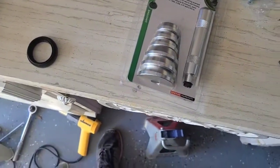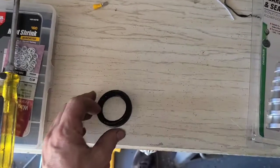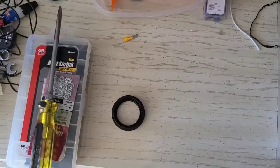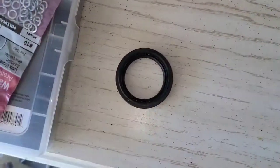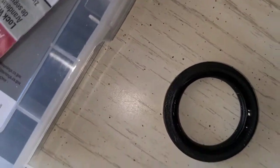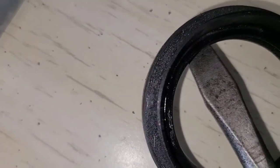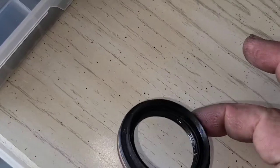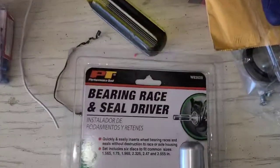I mentioned that I replaced the hub seal - this is the old hub seal, or rather axle seal. Replacing it requires removing the axle from the car, which is really the biggest part of the job. You've got to pull the hub, pull the axle out, and then the seal will be sitting in the hole in the housing where your differential is. To get the seal out, I took just a regular screwdriver and put it under behind the seal like this, and kind of slid it under there a little bit till I hit metal, then backed off just a hair so I don't scratch it on the way out. Then just pry it up and the whole thing just popped right out. That's the front side of it, that's the back side - transmission side.